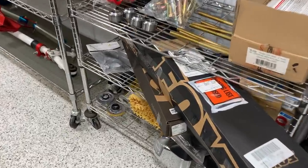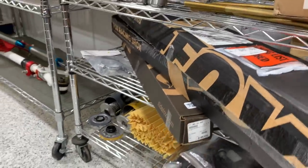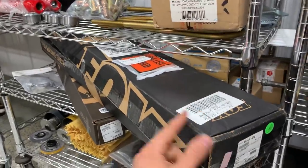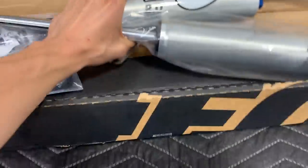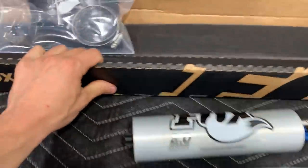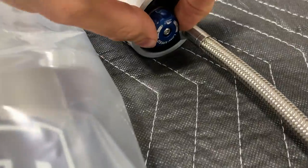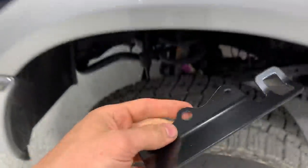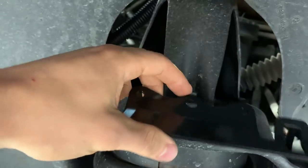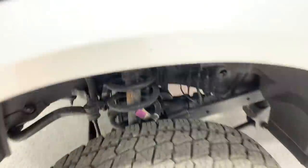For shocks, I took a slightly different route in the rear — I went with monotube, single tube, single shaft, no reservoir, because I may change to an airbag setup back there. Up front I'm keeping Fox shocks. Inside this box we have the Fox 2.0 Performance Series remote reservoir. The reservoir is adjustable — you can dial in how stiff or soft your ride is on the fly. It also came with universal brackets; my plan is to use an existing bolt off the spring perch stud so the remote reservoir sits right at my fingers.